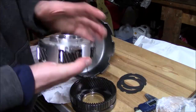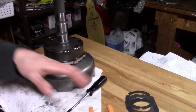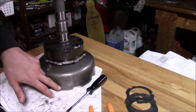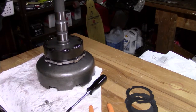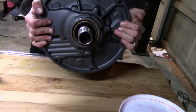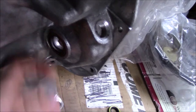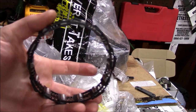These shims are pretty handy. I ended up shimming with three of these behind the thrust washer back in here, and that brings everything forward to better engage the castellations on the driving shell. This thing only has about 10 thousandths clearance now — way better than it was. Next sub-assembly is the oil pump, which is already assembled with new rings, new bushings, a new seal, and a new lip seal. Pump bolts get torqued to 15 foot-pounds. I also need to replace the case seal and start loading up the case, dipping this in ATF before putting it in.